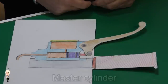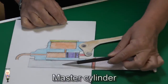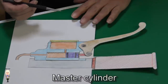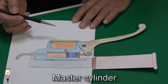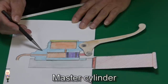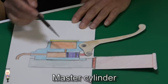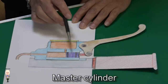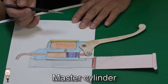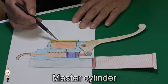Here are the parts. Hand grip and handlebar. Brake lever. The blue parts are the body of the master cylinder unit. The orange is the brake fluid. This purple part is the piston, and this is the return spring. The yellow is the reservoir cap with the green diaphragm underneath it.